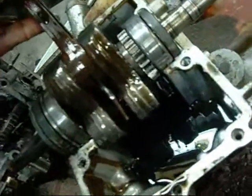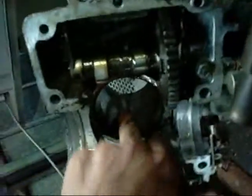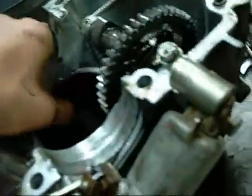It's really stuck in there. Crank bearings don't seem to have any play in them, but I might do them anyway. It's not my engine, so I'll ask the customer what they're willing to spend on it. Camshafts and governor are alright though. It hasn't suffered lubrication fail, it's just that there's probably rust in the bore. It's actually a bit hard getting the piston out because there's a bit of rust further down in there. Yeah, it's really rough. That'll hone out though.